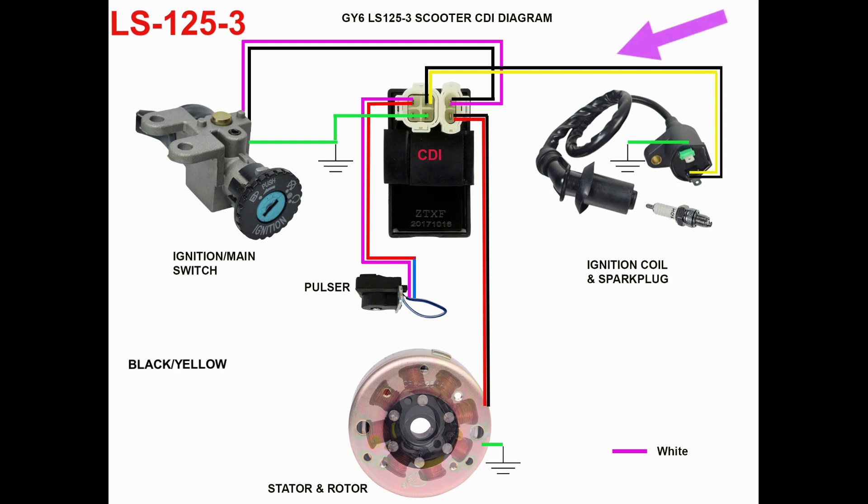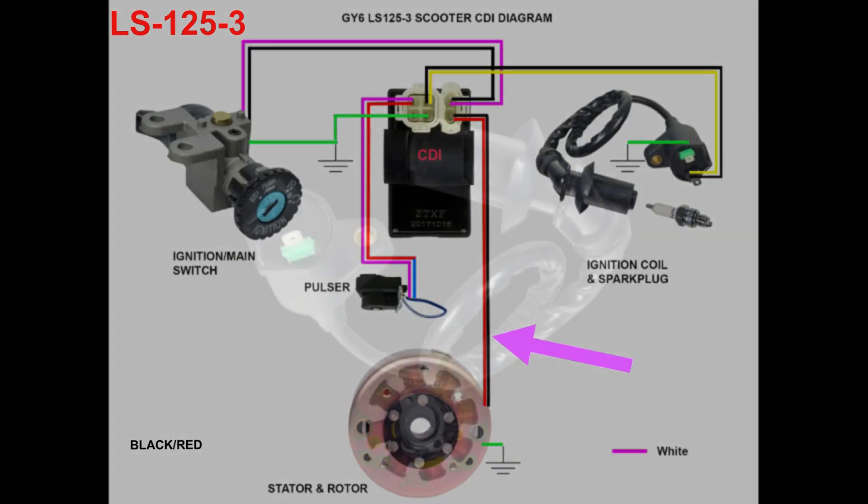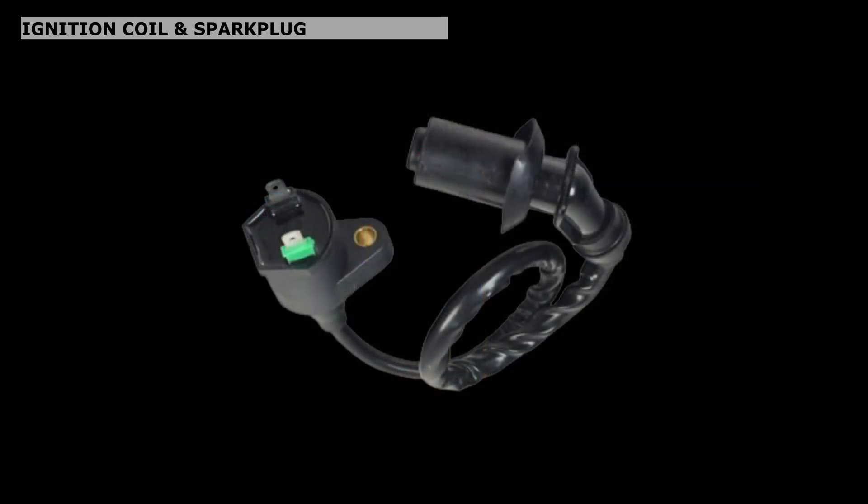The pulser sends a signal to the CDI; the CDI manages the signal and sends power to the ignition coil. Black with yellow stripes: this wire is connected to the positive pole of the ignition coil and is the output of the CDI. Black with white stripes: this is called the kill switch wire — it turns off the CDI when connected to ground; it is connected to the main key switch and kill switch on the right-hand switch. Green: this is the ground for the CDI. Black with red stripes: this wire is from the stator and powers the CDI with AC voltage — this type is called AC operated.